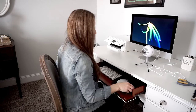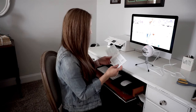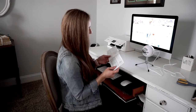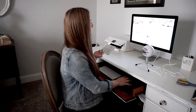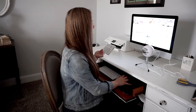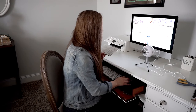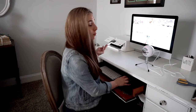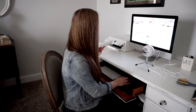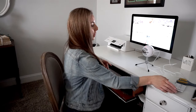You can see the light coming on after plugging it in. The directions say I need to go to System Preferences — I have an iMac so it might be different if you have a PC. It says connect via USB, open System Preferences, click the Sound icon, then click the Input tab — and there it is, the Blue Snowball. It says set the input volume to the appropriate level; the mic is sensitive and may require a very low volume setting, so I'm going to put it halfway and see how it goes. That seems to be all the setup needed.